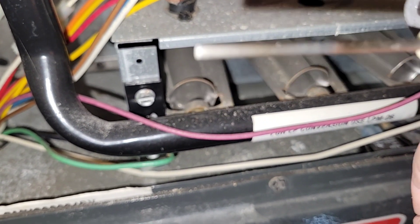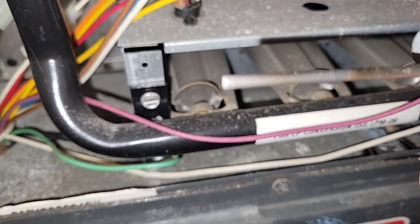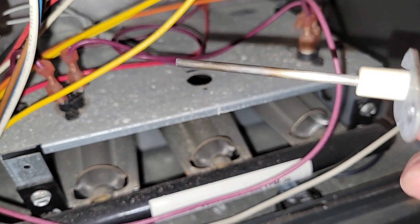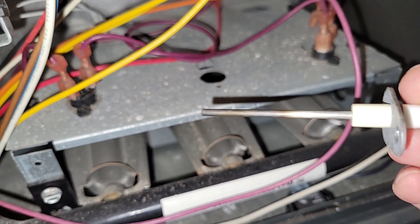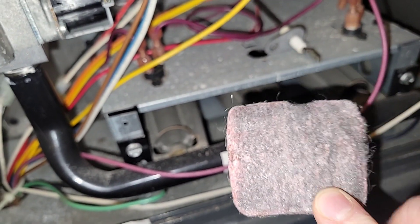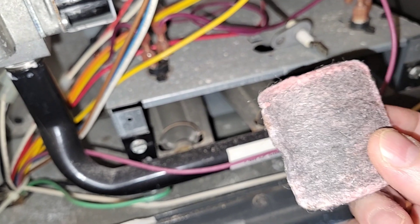What often is the trouble — all you need to do is clean this. What could be the issue is there's buildup on this metal rod, and all you need to do is rub it with one of these metal scrubbers. You can usually buy these for dishes or pots and pans.